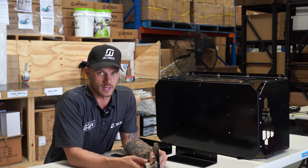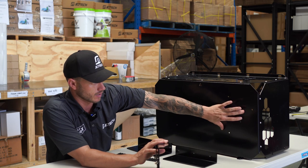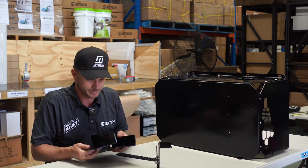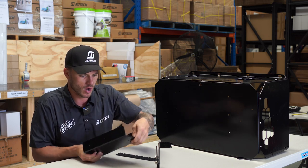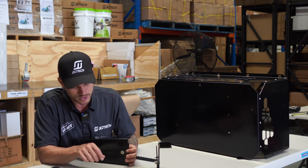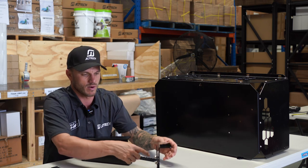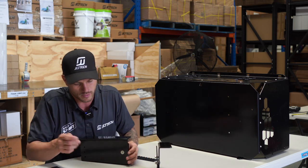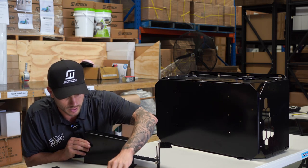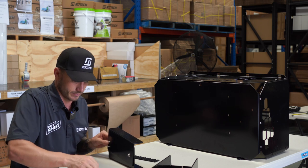I've got my feet facing in. If you wanted to, you could flip these the other way around and have the base facing in on the box with one foot facing out — doesn't really change anything. Line up the single hole and get your bolt through. I like to have the nut on the outside. The reason being: with the sled, when they face in they can rub even with the nose guards, so it's nicer and gives more clearance with the nuts facing outwards. I'm building this for our Yamaha outside, so make sure you get the larger bolts in the feet.